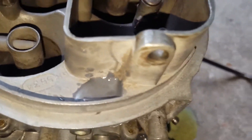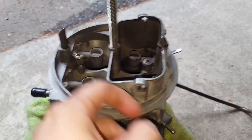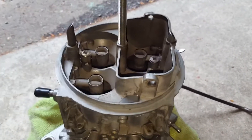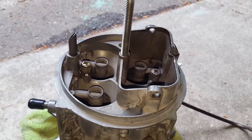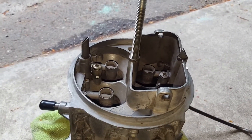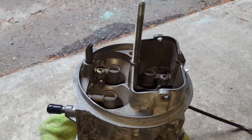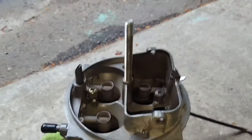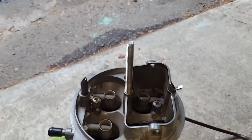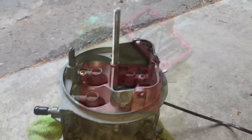I went a little excessive with the JB Weld — I just put a piece of tinfoil underneath, should have shoved it up in there and poured some in from the top. It made a bit of a puddle, but the tinfoil prevents it from dripping and ends up sealing that hole nicely. Now I won't lose boost through the carb hat through that hole. You can technically mill off the choke horn here if you really want to gain some extra airflow. You can also increase the length of the air intake horns with some hose or even brake line into the carb hat for better airflow, but I'm not going to worry about that too much.